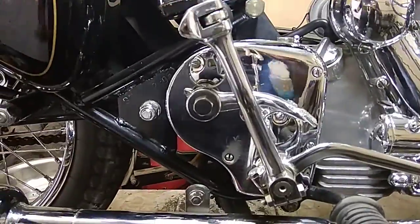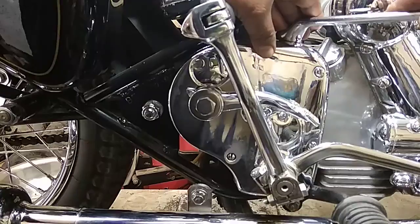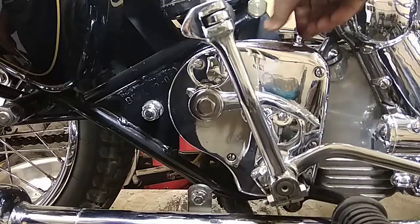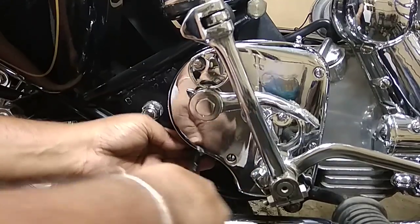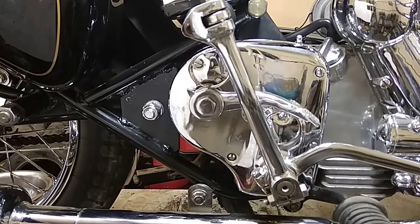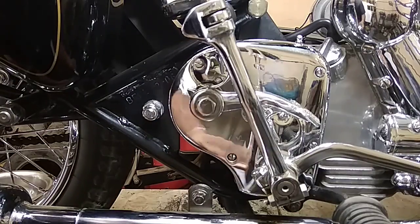Let me just hook up the camera. I'm going to open up the top plug. There's a copper washer — clean it up and you can reuse it, provided you put some Teflon tape on it. Keep a pan underneath so if there is oil, it will drain into the pan.